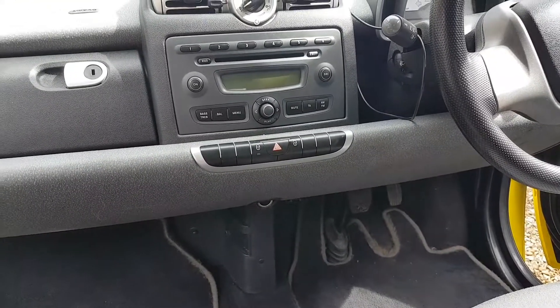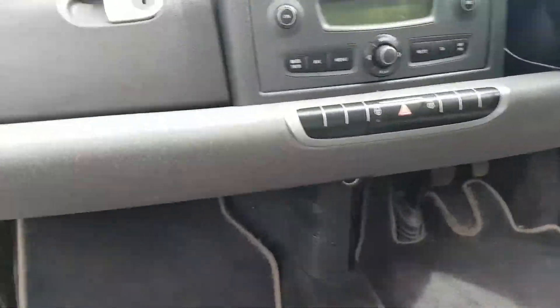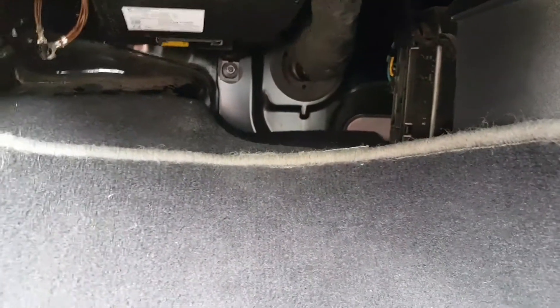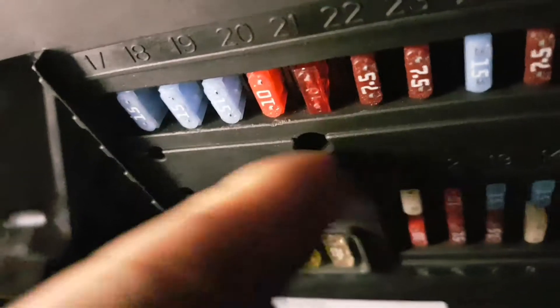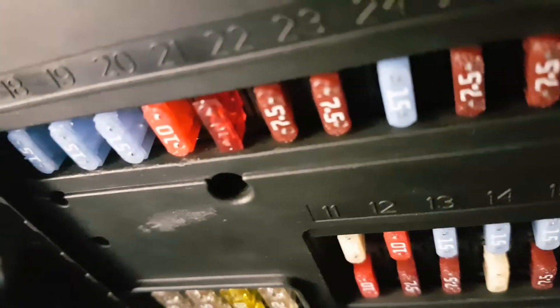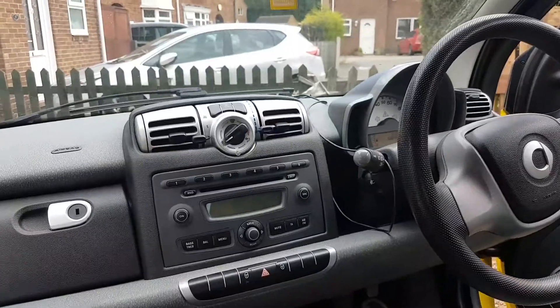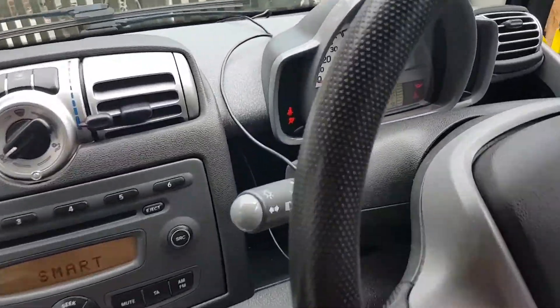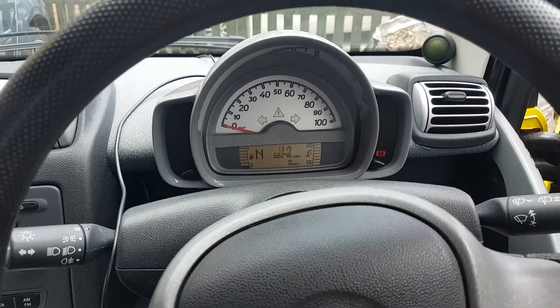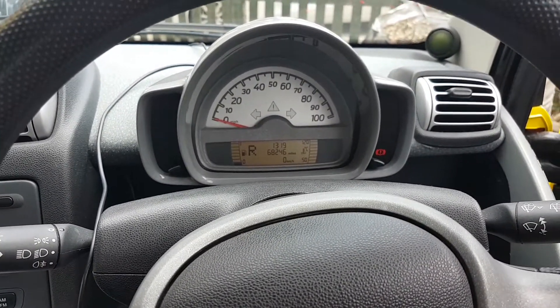Guess what — it's not acting up now, it's not blowing. I don't have the tripod for the phone because I've misplaced it; I've been through some rough days lately. The fuse is there — 15 amps, second fuse from the left. I'm going to turn the ignition on and as you can see the fuse stays okay. I'll also start the car — the ABS light goes off, there are no warning lights, and gears actually engage. I have drive again.